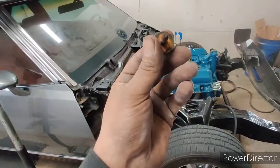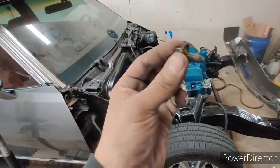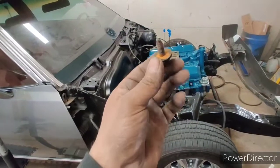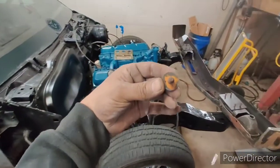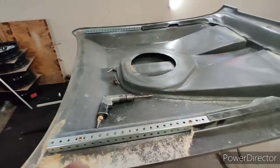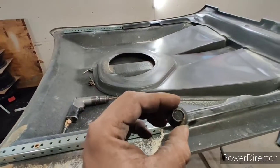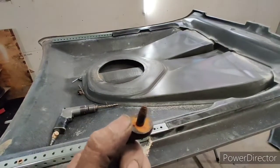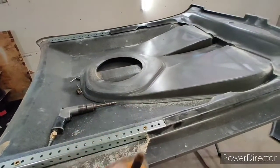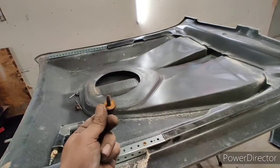They got a nice washer that's big. The thread isn't too big. It's going to allow some more mobility there. And it's got plenty of clamping force. Now keep this in mind. You guys think that going from a 3/8-16 bolt to this is going to affect it? This is a lot lighter of a hood. You should see some of the Honda Civics and modern Hondas. They use a 10 millimeter head bolt with a 5.5 millimeter thread that holds their hoods down, but they're pretty light, heavier than this for sure. So we're going to be good with this.